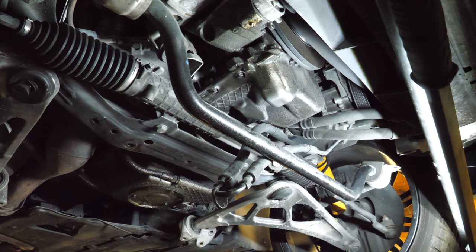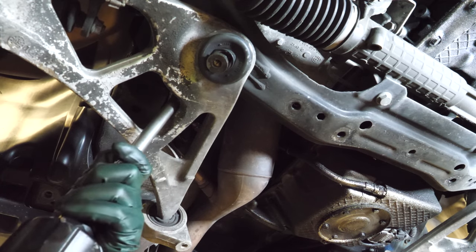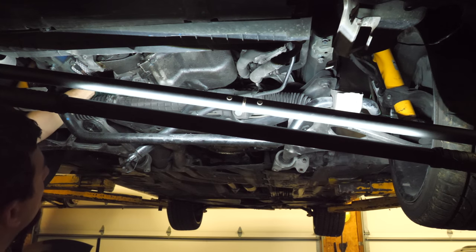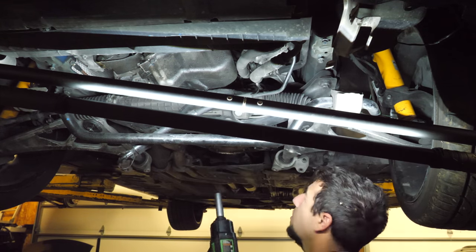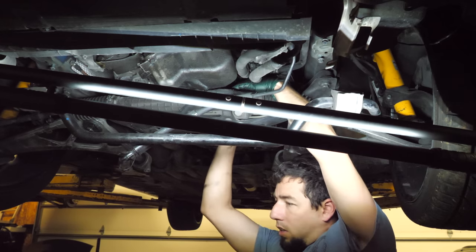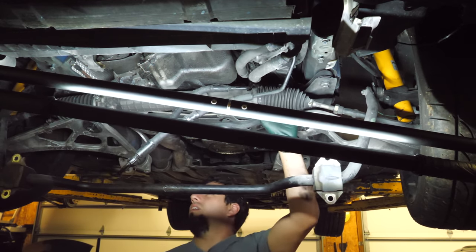There's a whole bunch — someone added some zip ties in here. That's not okay. I did notice this boot — it's kind of screwed up here. I don't know if I'll be able to save that or not. Hopefully I don't have to replace the control arm. Next I'm going to unbolt the steering rack from the subframe. This might not be a necessary step, but I'm going to do it anyway. That bolt is a little tricky. Now I think we're ready to drop the subframe — there's only four bolts that hold the subframe in.